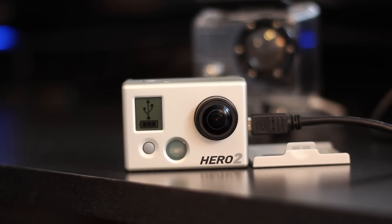However, there is a bug: if I set my camera to the one-button-on mode and my memory card happens to be about two-thirds or three-fourths full, the camera will only record 1, 2, or maybe 3 seconds before it stops recording. If the memory card is empty, it can record for a long period, but occasionally it will just randomly stop. The camera does not turn off, but the recording stops.